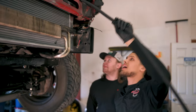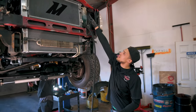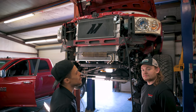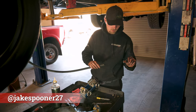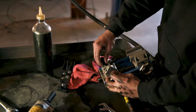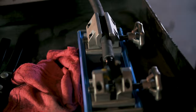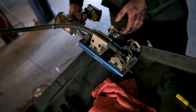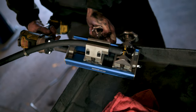Getting the line hooked up — some high-quality line that Chris got — so this will come around here. You can see those fittings right there; it'll flow more transmission fluid, and the cooler is bigger and nicer, so everything should stay nice and cool. When we do our hoses we use these little crimp clamps, slide that up there, tighten it in, and then we have this really nice tool that slides it up on there really tight — makes it a lot easier.